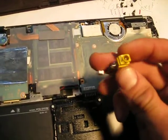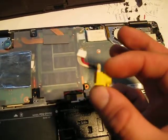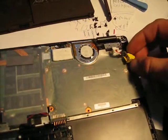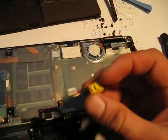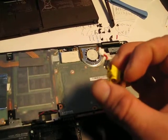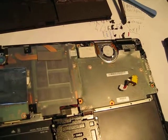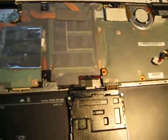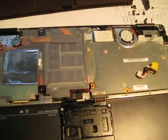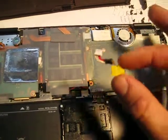This is fortunate because it's separate, but some of these yellow connectors are welded on the motherboard. If they're on the motherboard and they get a shock, it will destroy the contacts. Fortunately here we have wires, so that's okay. But usually you don't have wires on other motherboards — you have issues if you receive a shock on this connector.